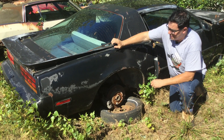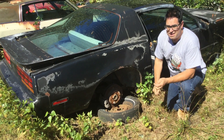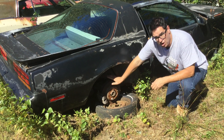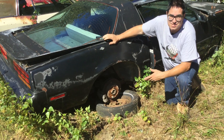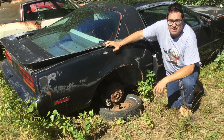The beauty of these things is that they are rated to 295 horsepower or 330 foot-pounds of torque, although it's actually pretty conservative. These axles are pretty tough, and these are a go-to grab-it-in-the-boneyard axle for owners of Gen 3 F-bodies — and here's one right here on this formerly beautiful '88 Formula 350 Firebird.